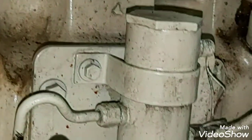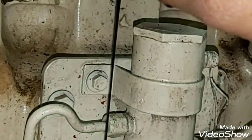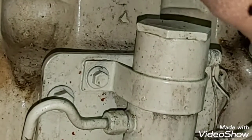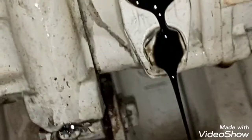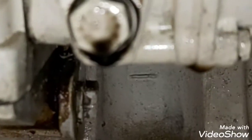The tool has been inserted in the flywheel, and the timing has also aligned on the fuel injection pump. If you can't see the timing mark on the injection pump, just turn it one round. After inserting the tool, don't forget to pull back the plug.